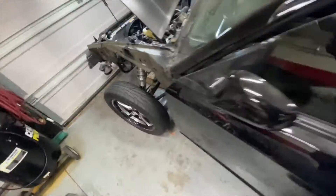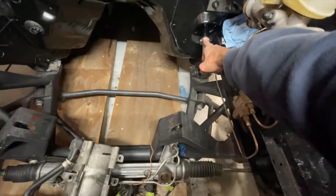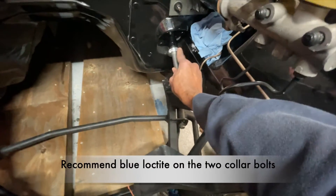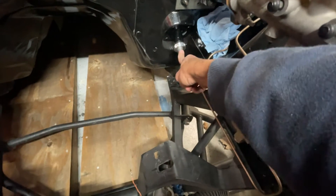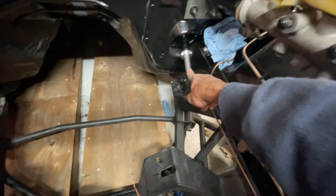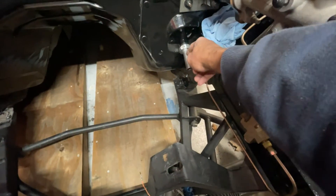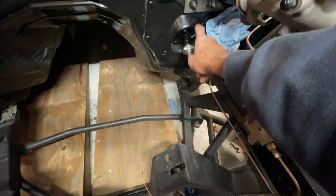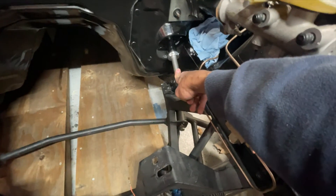Let's go see the other side. Now you've got to figure out the steering shaft arrangement. Motion says something about this silver collar — it can come off with just a couple of Allen head bolts that secure it. This collar just keeps the shaft and the rubber bushing in. If you had to cut this shaft, you take this silver collar off, push the shaft forward to come out, and take your bushing off. Motion mentions you may have to cut this shaft, so we'll see on that.